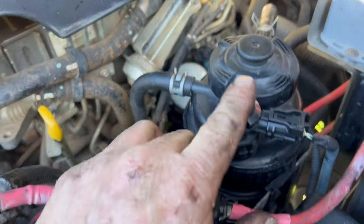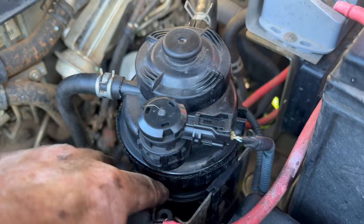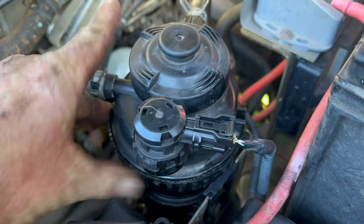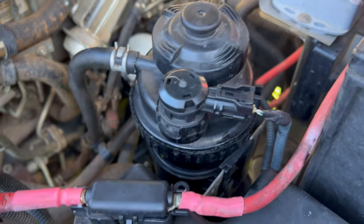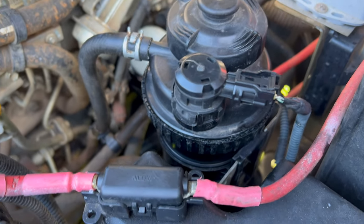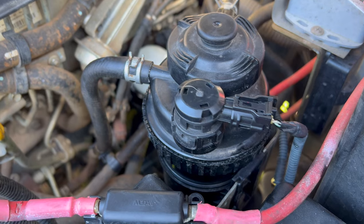I had trouble with this — I hate this. It's a fuel filter. It takes an insert inside this and there's a ring which you've got to undo a certain way. Every time I go to change the filter, it's a real bugger to get this ring undone and I'm going to break it at some point. So what I'd like to do is modify it and just have a screw-on canister type filter. I'll have to look into that a bit.